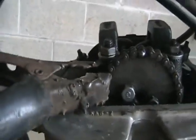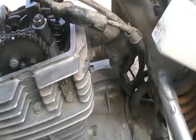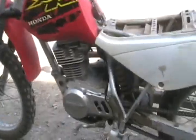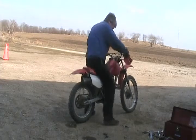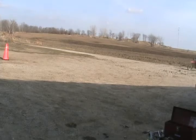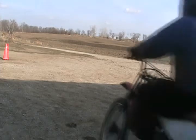Of course I put the ground right there - it grounds the sprocket and chain. That's tightened, that's lined up, that's tightened. We're all set to put the cover back on. Drain the bowl on the carb because it hasn't been started in eight months. And see if it fires up in one kick. This is going to start with a redneck timing chain quickie repair - took me about 40 minutes. Yes! Perfect!